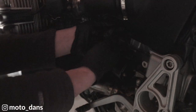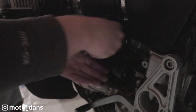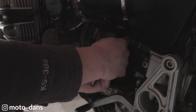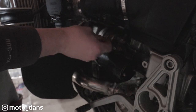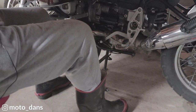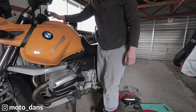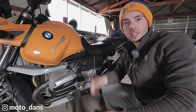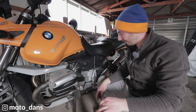Cool. And I'll take my tape off of this. Again, be careful with your spanner. If you want to remove the battery, if you check out a video above you'll see how to remove the fuel tank and disconnect the battery. You don't actually have to remove the fuel tank fully — you can just take the back bolt up and lift it up a bit and you'll be able to get to the battery negative terminal. Perfect, that's much better. And that literally took 10 minutes to do. Great, job done.